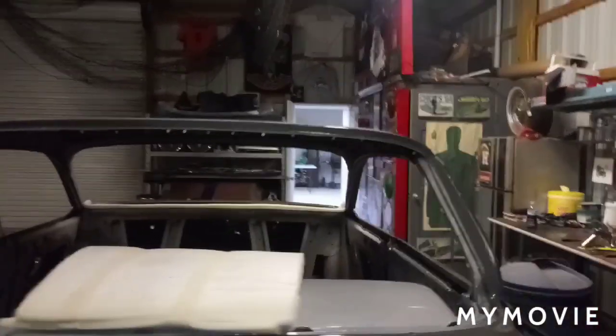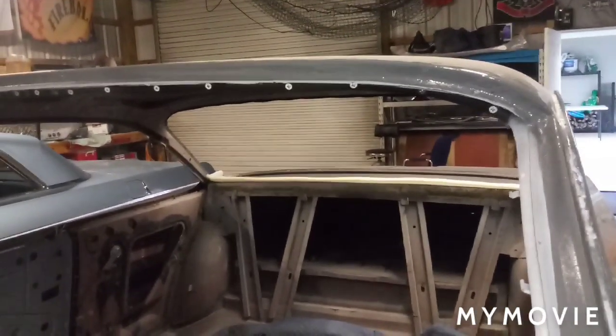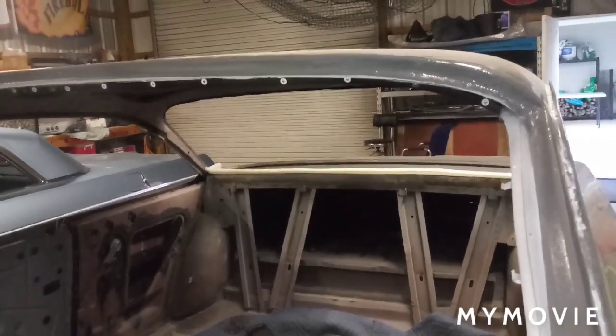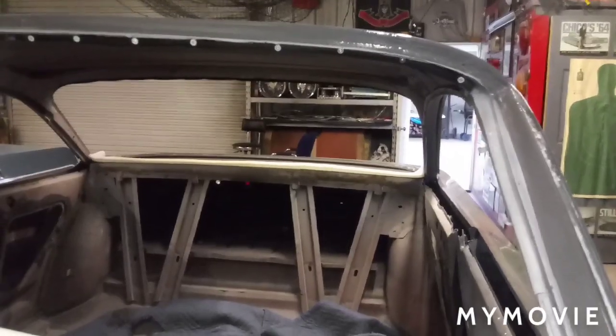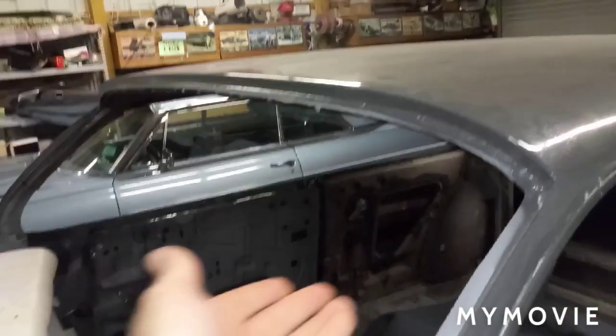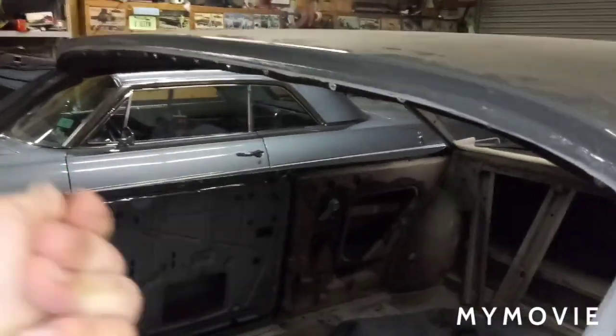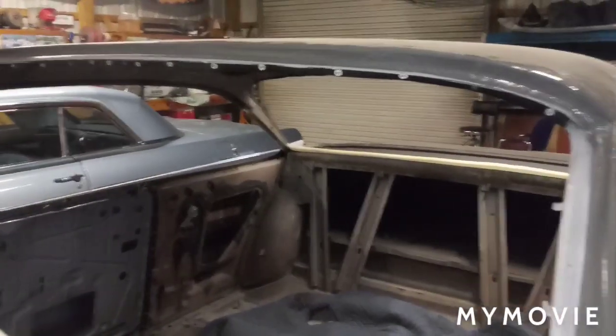I think it'd be easier to just kind of pry out the old tack strip, hammer the staple back in, and then the new tack strip will cover it. Also, I think the headliner should be done without the glass in — I don't see how people do it with the glass in. For big guys it ain't gonna happen. It's much easier to reach for the fabric, pull it and staple it than it is to try to do it with the steering wheel and dash in place.